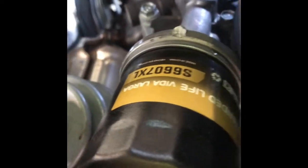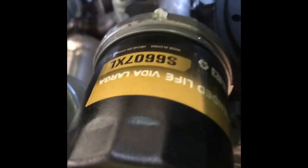Alright, I'm fairly confident everything should be buttoned up tight enough. Take a quick look — there's a little bit of oil on my washer but I believe that's just residual, it's tight enough. You have to run the vehicle for a while and just look for puddles — not in the same spot the vehicle is parked obviously. Wipe down things as good as you can, take a look around. There's always a chance you didn't tighten the filter up enough. Pretty much crank it as much as you can without overdoing it — hand tight. You get a feel for it eventually. Always come back under and don't drive far without double checking after an oil change.